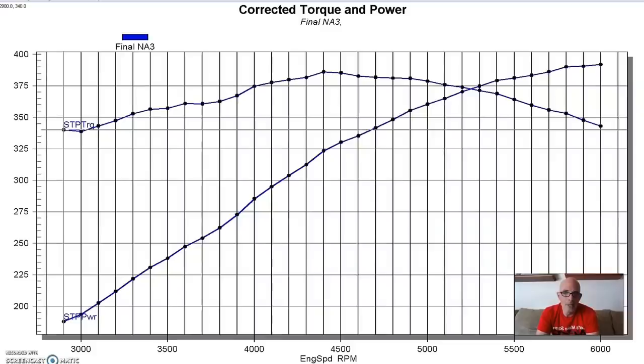If you look at the impeller on the centrifugal blower, it looks an awful lot like a turbo - and in fact it really is. The only difference is instead of being driven with the exhaust, it's driven off of the engine. They get the impeller up to speed through an internal step ratio combined with additional speed from the pulley ratios.